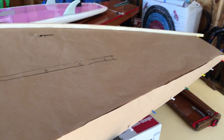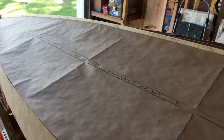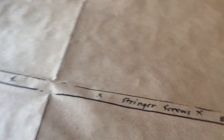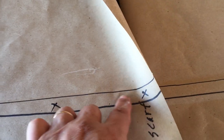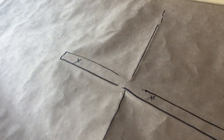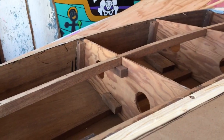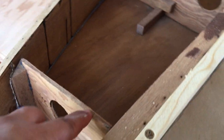We have a pattern for the bottom panels fore and aft. On those, we marked a little template that shows us where the stringers are underneath. When we get the new panels on, we can lay this over the top, drill some holes for number eight by three-quarter inch screws, and that helps hold the panel down. On the other side, it's not glued to the boat, and it's also not glued on these frames.